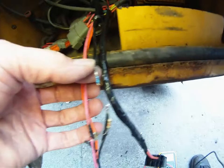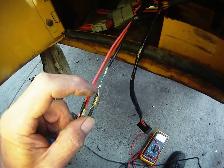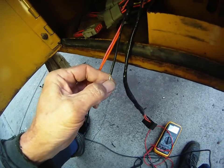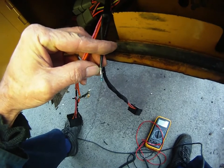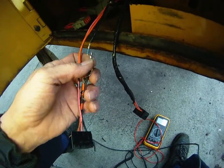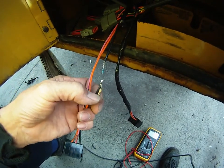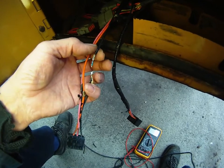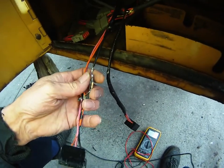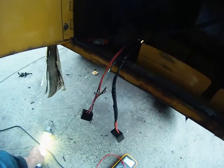Now this resistor isn't the same as the factory resistor. It's soldered on there — the smallest size 5k resistor you can find — wound around the wire and soldered on, which of course broke in no time. The original resistor that was in here is gone and presumably that one broke too, so someone stuck another one on there pursuing the same path to failure, and it also broke.